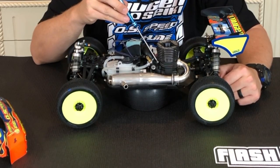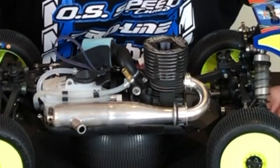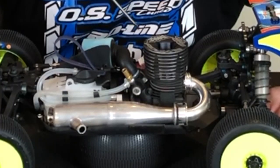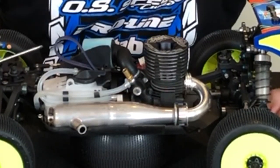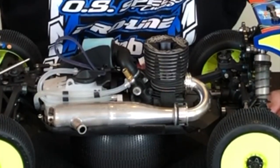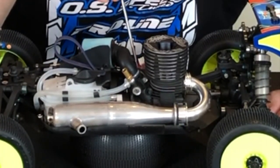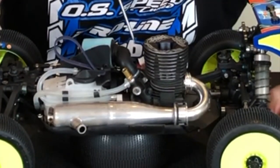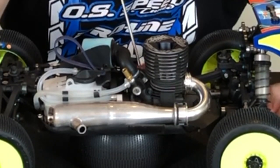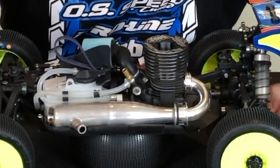To the right of that, this really small screw is the idle stop screw. This is going to control how far the slide closes and will control the idle of the engine. If you screw that in it's going to raise the idle; if you screw it out it's going to lower the idle. Another thing to consider is that the idle and the low speed adjustment can kind of go hand in hand. So if you make an adjustment and the idle comes up because you leaned the low speed needle, you may also want to make a one-hour adjustment to back the idle screw out.